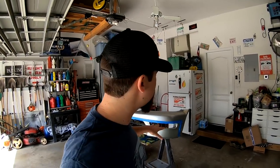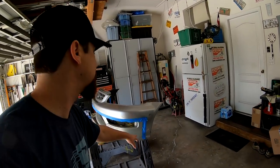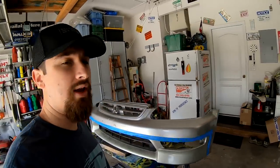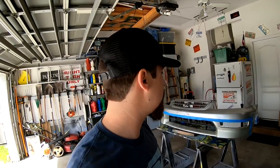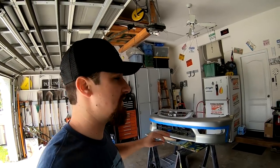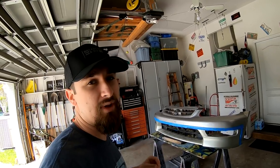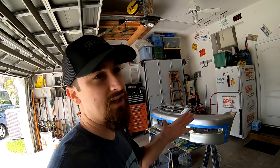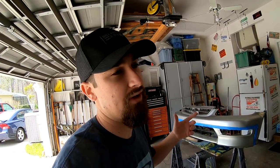At this point I just kept trimming and trimming until I had it where I liked it. It's a pretty basic shape — right angle up here, all the way across, and then down there the same way. Now that it's all together, I just have it mocked up with tape and it's looking pretty good. I'm going to go in the back and plastic weld it all together. I'll put a metal screen in there to reinforce it, melt the plastic that's already there so the screen can sink into it, then reinforce it with more plastic from the plastic welding kit.